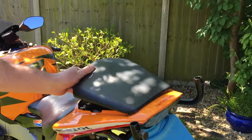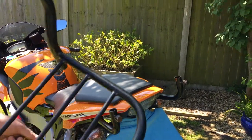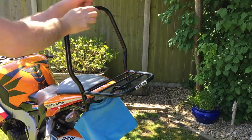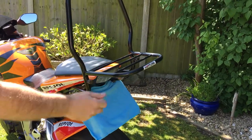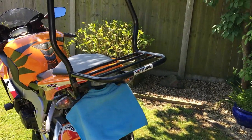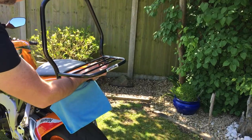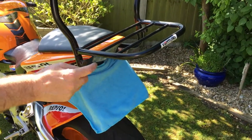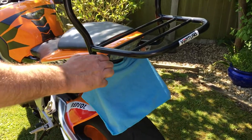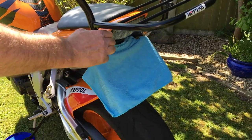Now I'm going to put the seat back on the bike and show you the pack system — it fits on like so, nice and easy. I put a little bit of grease on the inside just to make it slide in easier. Then you have two fixation bolts, and Ventura supply a little key to tighten them up. Again, don't over-tighten these — there's a little ridge inside and if you over-tighten you'll pull a hole through the bar and strip the thread.